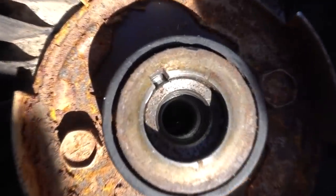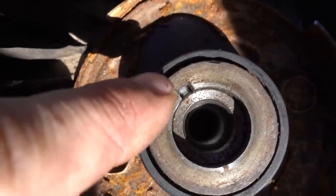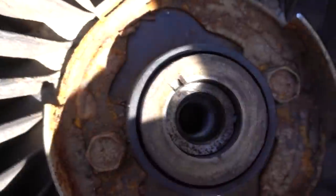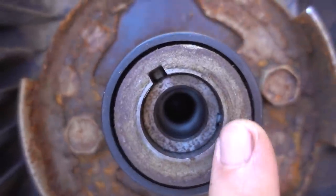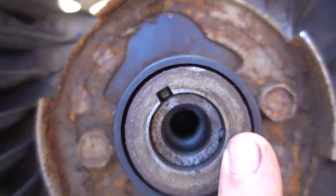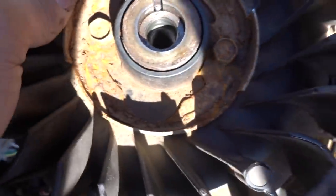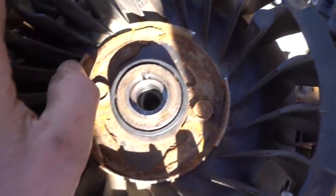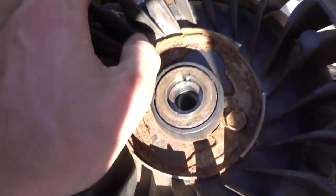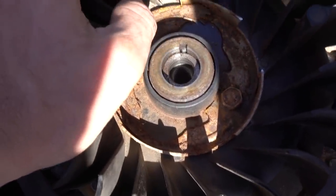After taking off a few bolts, you can see there's the flywheel notch there, and then in the shadow here, of course, there's where it's actually supposed to be. So yep, we sheared it, and I don't know why that is, other than maybe my air compressor didn't put enough torque on it and it just wasn't enough. Huh, I bet you that's what it was.